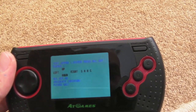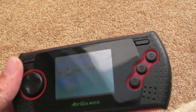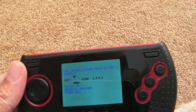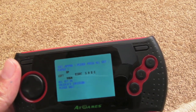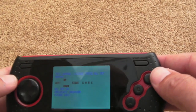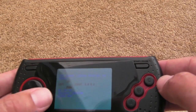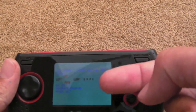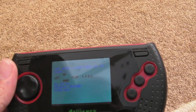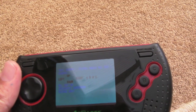So as you can see, the directions are alright — there's actually nothing wrong with the directions, it's a red herring. The FPGA, the Firecore firmware, is obviously booting up and seems to work okay, but then there's some sort of crash or hang. And I think that's why the controls appear not to be working — it's just locked, it's frozen. My guess is that the checksums are either going to be incorrect, or there's something else wrong with the internal part of the Firecore emulation. It's hard to tell.